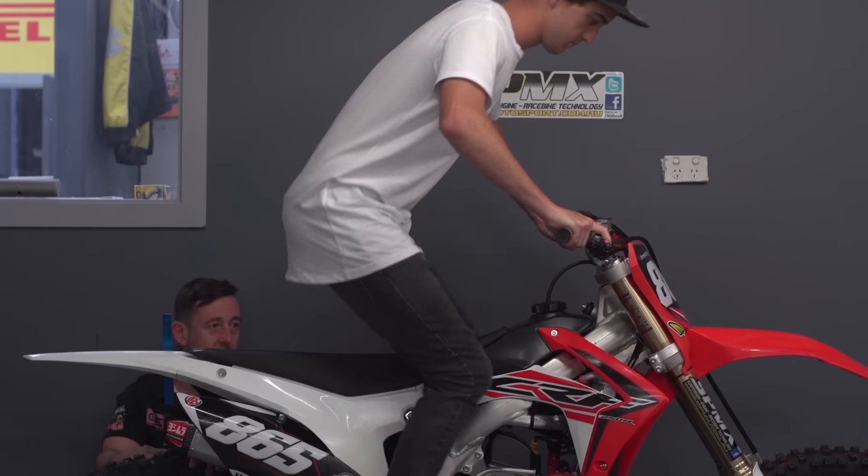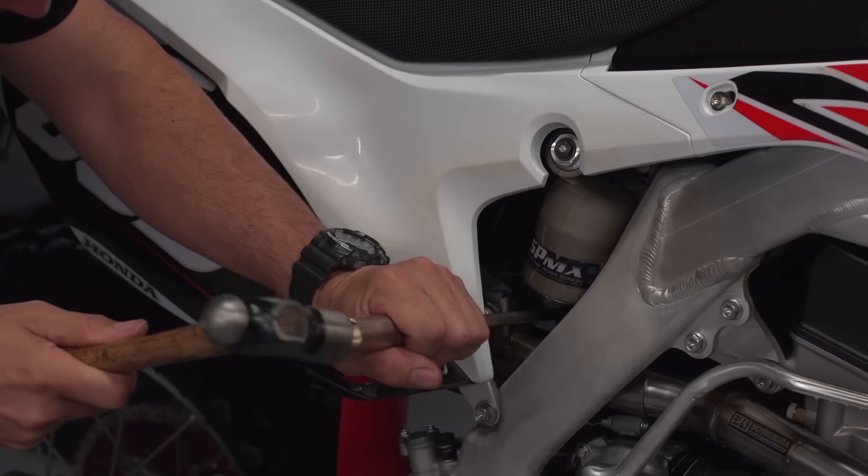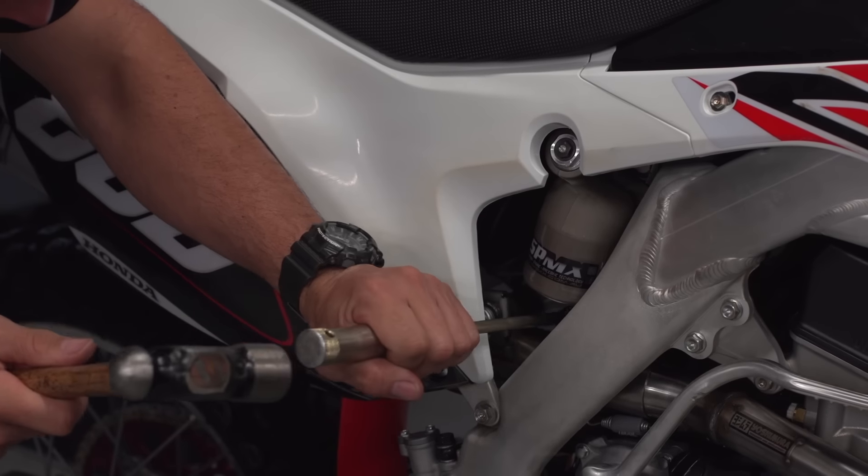It's a level one of our customer SPMX setup. There is room to move from this setting with some upgraded parts — we can use some SKF low friction seals in both the fork and the shock. They all obviously add to the total price.